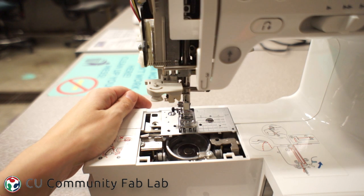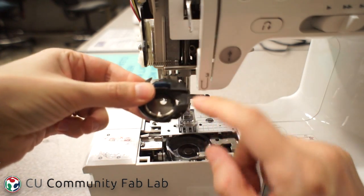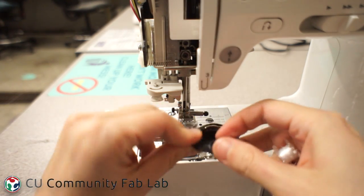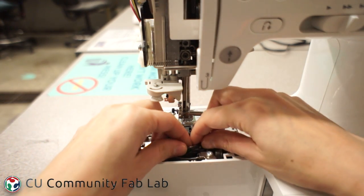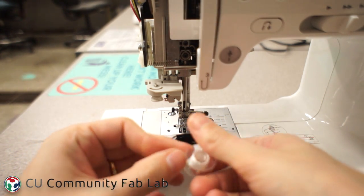This machine is running smoothly, so I'm going to close it up. The second common problem with sewing machines: if you or a patron are sewing and you hear a terrible noise from the bobbin carriage, or the carriage pops up against its cover, it's probably a burr on the carriage causing it to pop out of place. A burr is a scratchy bit left on the carriage from the needle piercing it, and it usually happens when the carriage is put in incorrectly. Fortunately, it's easy to fix — get some fine-grit sandpaper and sand out the burr, and the hole left by the needle shouldn't be a problem.